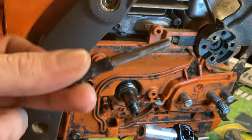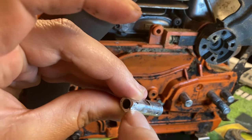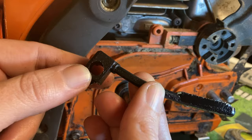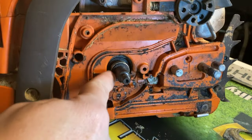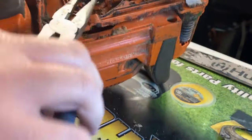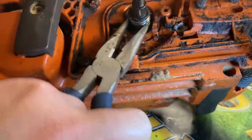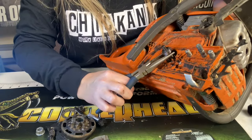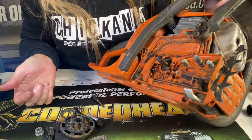It has to have a new oil pump. This piece is probably still in good shape — there's a little nick right here but not enough damage to make it not work, so I think that's going to be fine. The oil line still looks good too — no holes — so we're keeping that. We do need to get this existing piece of worm gear off the shaft first. I'm getting underneath here and it's going to pop off — yep, there it went. The shaft still looks good, so let's get some new parts.